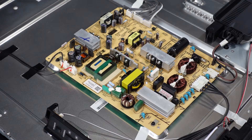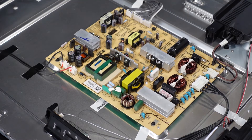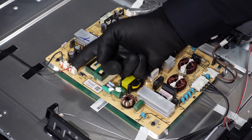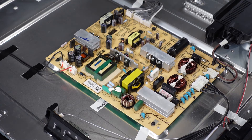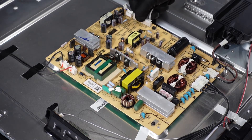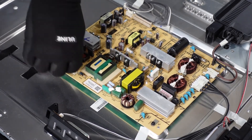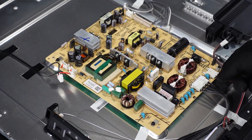First things first, we're going to work with this power supply. Take note — we've got six cables to get removed and then just a handful of screws on the outside. Looking at these, they're all going to be the same: pinch with your thumb on the lever and pull out. These here — pinch and they come straight up out of the board. Pinch with your thumbnail to release the latch and it comes out just like so. Same with the next one — pinch, pull up. Same with the two on the side — pinch, pull up, pinch, pull up. These here are the same situation, only we're going to be pulling out instead of up.